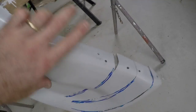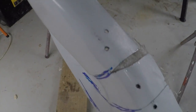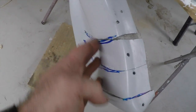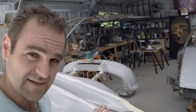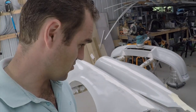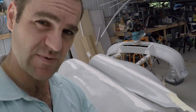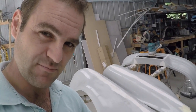Okay, so the finished product is not that pretty, but it does the job. So that's all held together. Now it's a matter of bogging and smoothing that out, and it'll be all good. You can see here. Alright, now that I've got all the fiberglassing done, I'm going to go through with the fiberglass body filler to bulk out some of these edges a bit more. There's a framework there with the current fiberglass, and using the other fiber filler, it all bonds together and gives it a bit more structure.